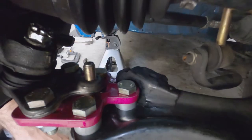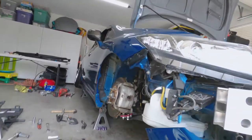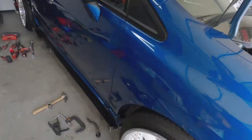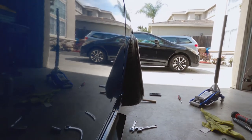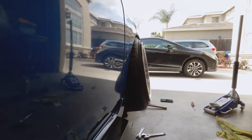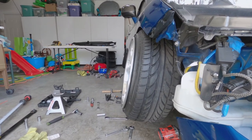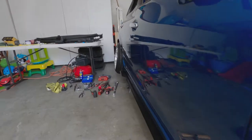Now the tie rod fits and I'm on the second hole. With the wheel on you can see little tilties — I can definitely tell there's more camber than before. Looking at front versus rear, it appears to be about even now, roughly 12 and 12. On the last hole it was probably close to negative 16, but on the second hole looking straight down it's pretty much even all around.